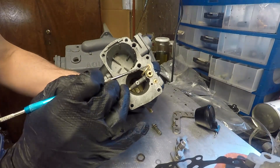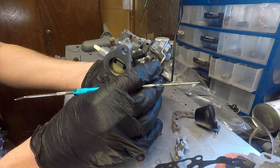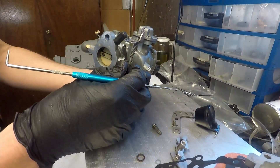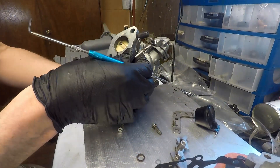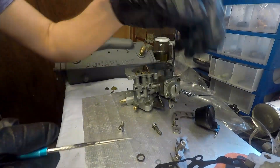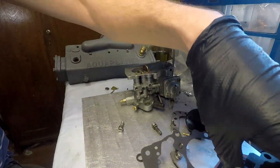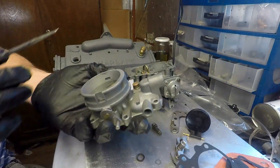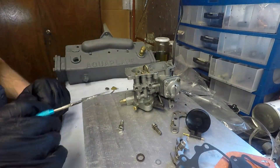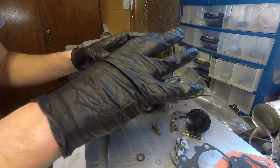This is the idle air, and this is the discharge for the accelerator pump. The accelerator pump is here, and it has a traditional diaphragm-type accelerator pump. This is a very conventional setup in that sense. I've tested the float and it is okay, and I've changed the needle and seat assembly. I cleaned this out, and this is the choke flap — all very clean.